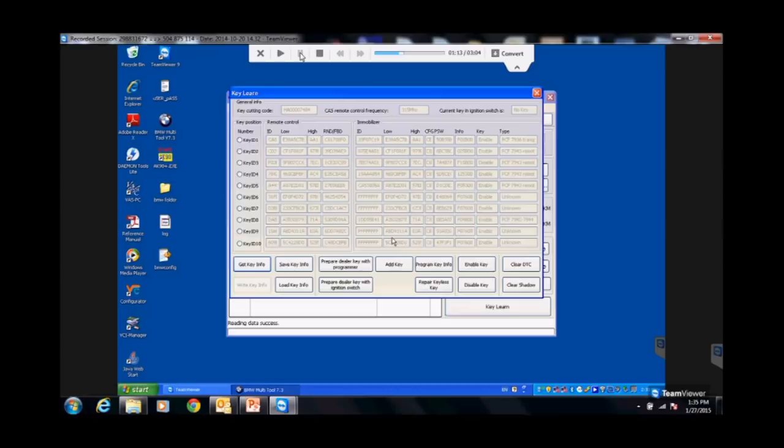Secondly, the other scenario is he doesn't come back to you. He goes to the dealer for some reason, non-related, or to a mechanic, and we go to change the EWS, or we order a key. So now we're ordering key number 8, because they lost 7 keys along the way in 10 years. Now that key doesn't work. Well, the dealer is going to put in an engine computer, they're going to put in a CAS unit, they're going to put in $1,500, $2,000, $3,000 worth of parts. Please believe me, that customer won't mind if you reprogram his key. You can take his key and put it back into that slot.